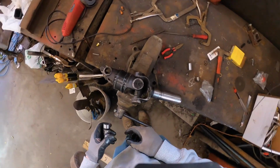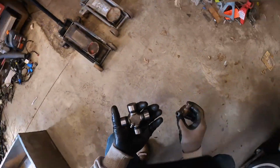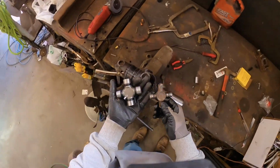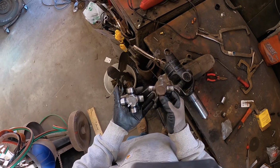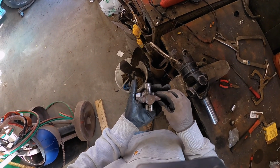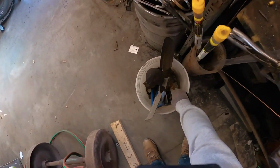Then you pray that they gave you the right U-joint. Now I'm not sure, since I just trucked that puppy, which side's which. Y'all might want to make sure before you throw away your old U-joint which one's which. Your difference here, we had a solid U-joint installed, or I did, when this drive shaft was built, and I was told that it should take the power that the stock diesel has, and it's pretty evident that it really did not. So that's trash.